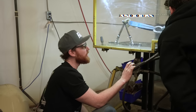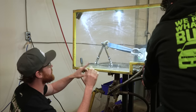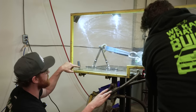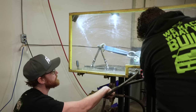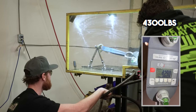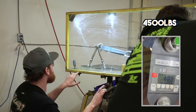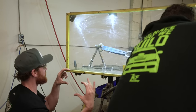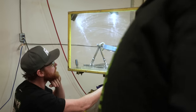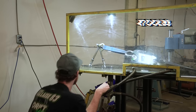So we've reached 3,500 pounds. Because it's an A-frame, you're going to have compression on one side of the arm and tension on the other. We've got compression here, tension here. You can kind of see it's pushing this heim joint down into the table and it's trying to pull this one off. We're at 4,000 pounds now. We're at 4,300. We're at 4,500. I can kind of see it pulling the heim joint away from the stud. We're at 4,500 and we lost it.